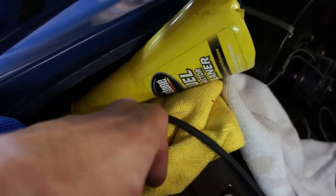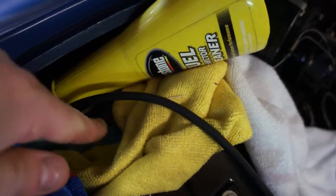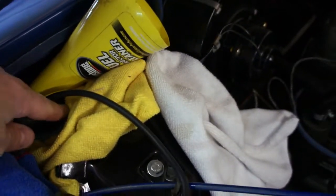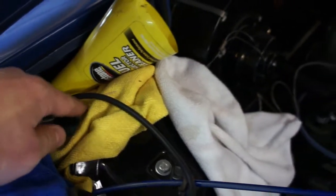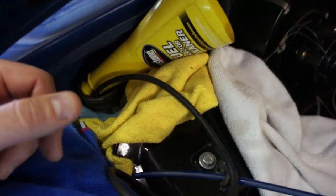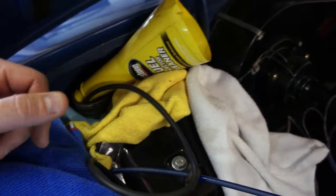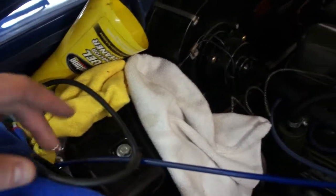My MG has one exit line out the top — there's one exit line right there that comes out the top. So I figured the air should be at the top and come out the line, and it shouldn't get stuck in there. But in order to not have to do a bench bleed, I tried to find some solutions on YouTube and this came up, so I figured I'd give it a try.